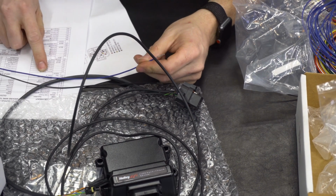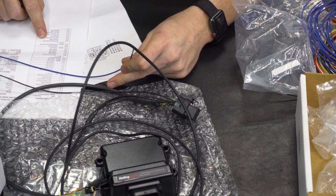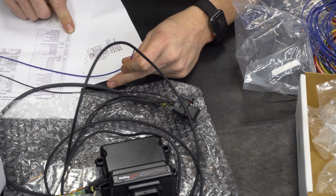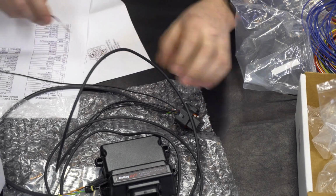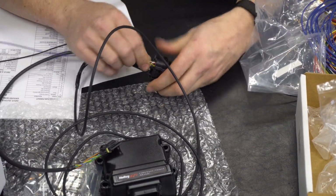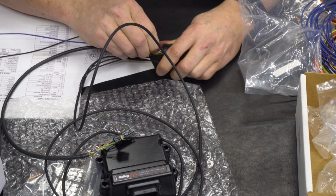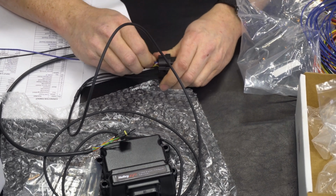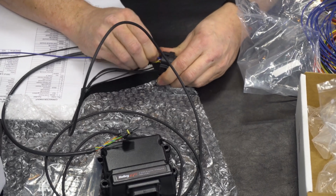and we're using 12 and 13. I'm going to find my first one, which it looks like 5-volt sensor power is there. 5-volt sensor power, there's one on 10, which makes it very easy because 10 is right on the other side of this wire. Double check, yep, 5-volt sensor power. Push this one in till it clicks. And it's not quite locked in yet.